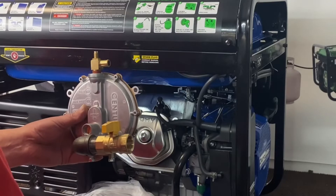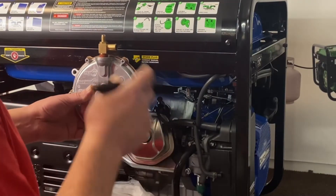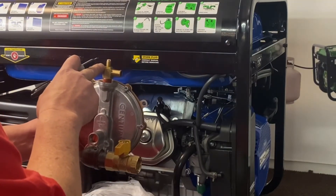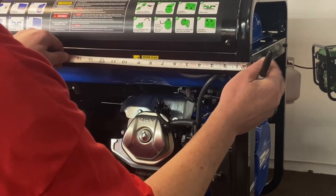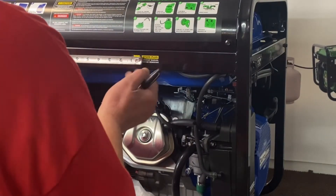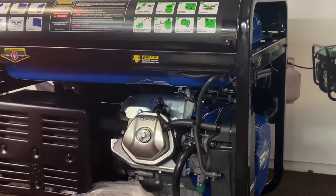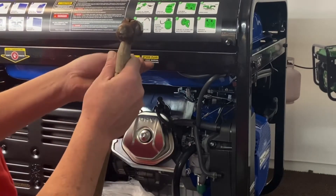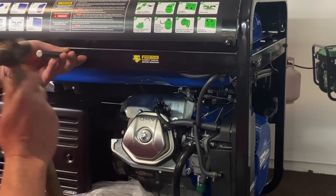Now we're going to mount our regulator assembly to the frame. We figured this would be the best spot — it's closest to the carburetor adapter so we'll get a real good signal. This will come all pre-assembled for you, though you might need a minor adjustment depending on your pressure. From the side of the frame, come over and mark eight and a half inches, going into the center. From that mark, come over five and three quarters. That gives us our center-to-center for mounting this unit. I use a punch to keep the drill bit from wobbling — go ahead and get both points marked.